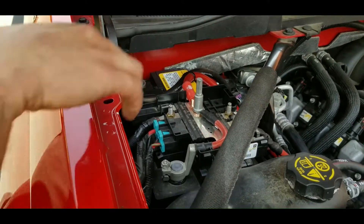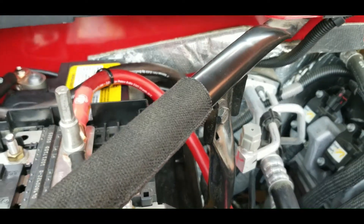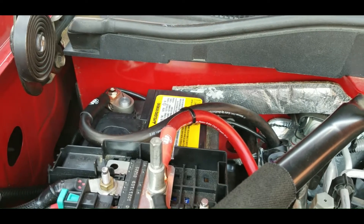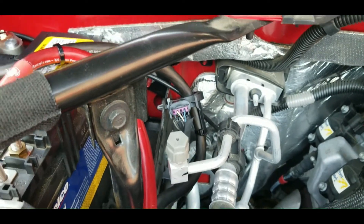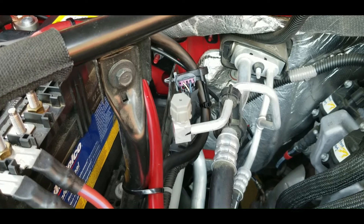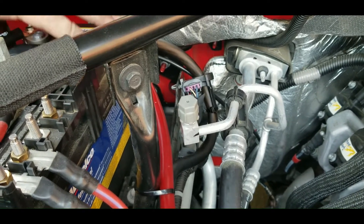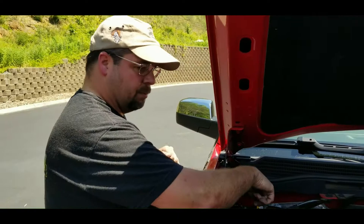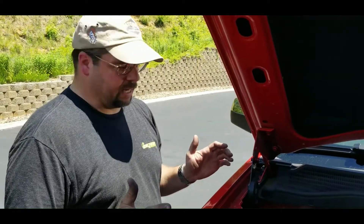You can change it if you want, but it doesn't do anything except give you a lighter wallet. The way we've got this ran — one single ground wire is all you need at the right size. You don't need five, you don't need a block with 12 on it. You just need one good quality wire. All it has to do is run right back through this RVC sensor, then it goes straight to your alternator. There's also one little wire that's a ground for the vehicle — it will easily fit through that loop. You've got to have those two. If any grounds you have are not running through this sensor, it's going to cause weird things to happen: low voltage, maybe a charge light.